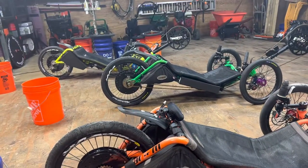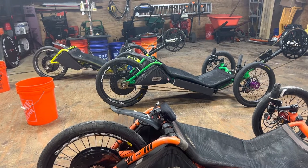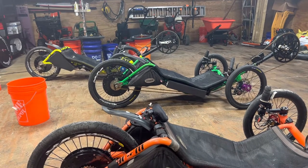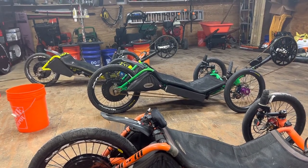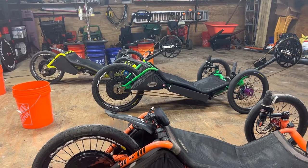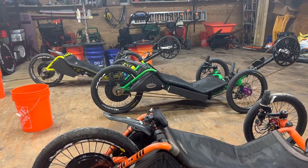Here are my three bikes. We're mainly going to talk about trikes, but on upright bikes most bikes you buy nowadays have the battery built into the down tube — it's in the middle and down low. The down tube is the lowest member on the frame, and even homebuild setups usually sit in that area. The theme is getting the battery down low and in the center of the bike, whatever bike you ride. You want that for handling, performance, and it's also a safety issue.